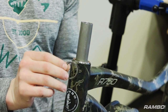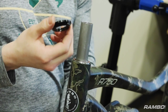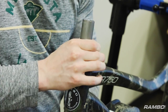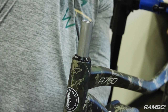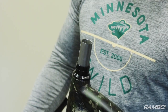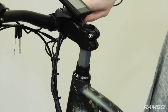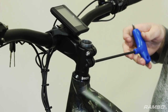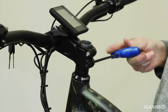If you remember, these two little shims here went on first. After that, it is this little Niko bottom piece here. If you remember the order we had it in here, it was two spacers on the bottom. After that, the next part you're going to put back on here is the stem. You can tighten these bolts back down — keep your 5mm Allen key close — that way it'll kind of clamp it from falling back down.